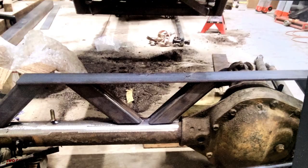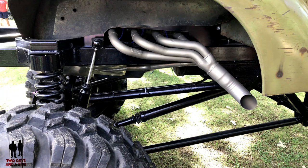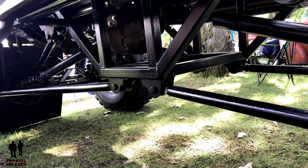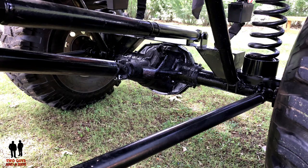On this truck you've got fully hydraulic steering, which is something new you haven't had on your other mudding trucks. I've never had a full hydraulic setup. The best way to explain it is anyone who's driven a forklift knows it's got a sway to it. This truck does the same thing when we get into second and third gear — when we're going pretty fast on the road it starts to sway and wobble a little bit, but that's just the nature of having hydraulics.